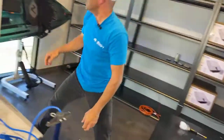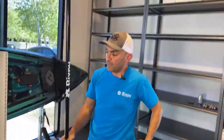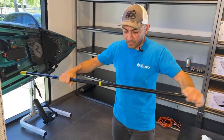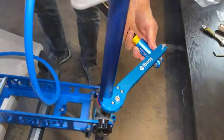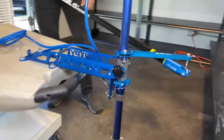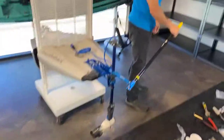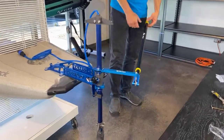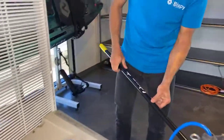We don't ship this pole, but you can buy your own — it's extremely expensive for us to ship. You can pick these up at Home Depot or any hardware or paint store. This one is a cheap telescopic one, about $15 from Home Depot. You can also buy a really nice $80 one. It goes right in there and now you've got steering. If you're sitting on your kayak seat and want to steer your motor, this is all you need. You don't need to swing your arm in big angles — just swing your wrist and you're steering. You can put this down beside you on your seat and it'll keep you straight. In choppy water, put a little bungee over it and it's not going anywhere.